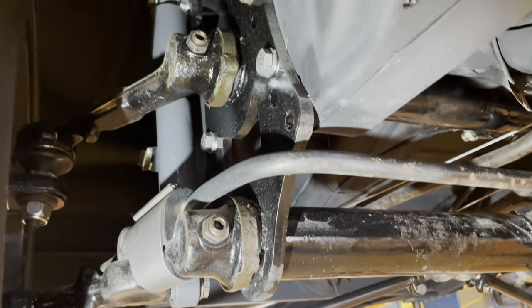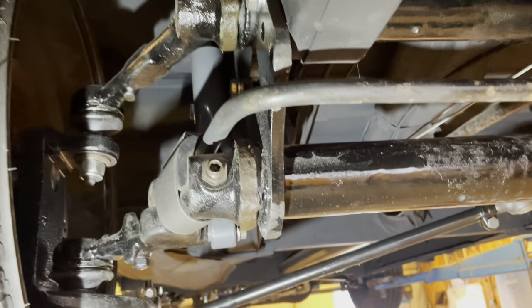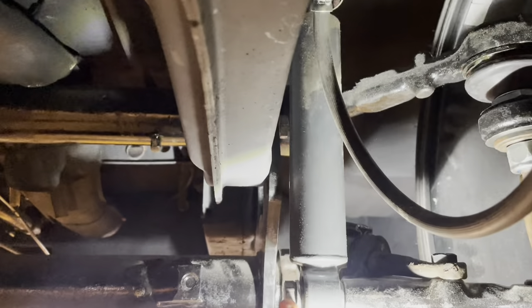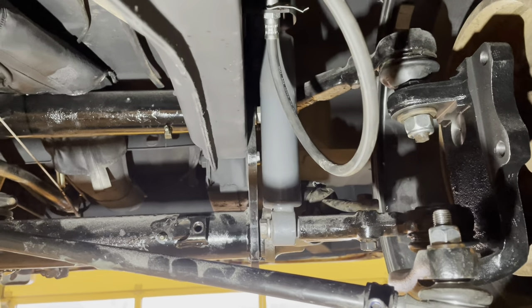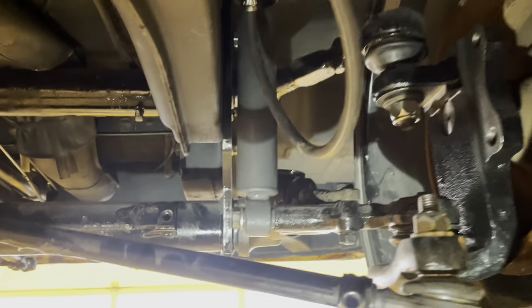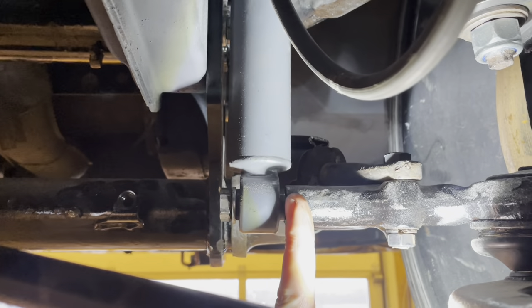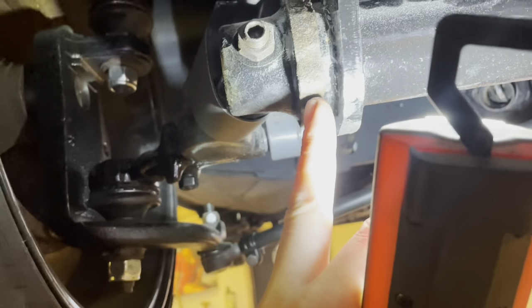You only need to narrow the beam a little bit. On a bay window there's not a lot of room for the shocks anyway, so you're pretty much at the maximum. The shocks line up pretty tightly and I'm keeping the original stock shock mount. Some companies make a bracket to move the shock inward so you can narrow a bit more, giving you slightly more room to play with.